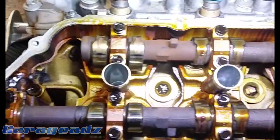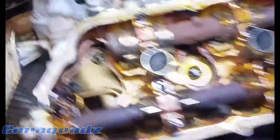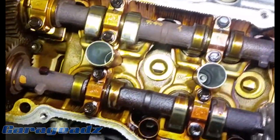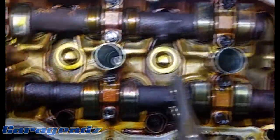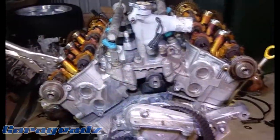I did wash this out a little bit — I just used fuel. This is the forward bank. So the rearward bank — you can see how much heat the rear bank gets in comparison to the front bank and how badly they stain. Now this is just a bit of a design thing with the 1MZ, because usually the motor literally sits like this, so the other bank is sort of down here and they sit a bit lower. It makes me curious about the oil flow characteristics of it.